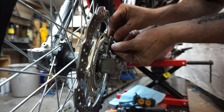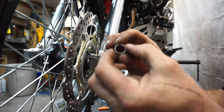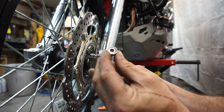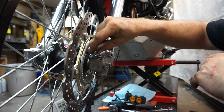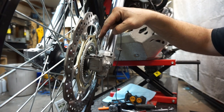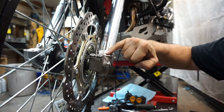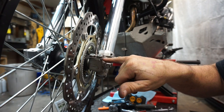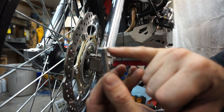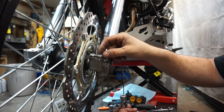We can recheck the sensor — that's good. I have cut rings here, and the ID is the same as the OD on a socket head bolt. We're going to drop these over top and weld them to the plate, so when we put these bolts in, it's going to be perfectly aligned — basically using the heads as dowels and these as locating rings. I left them just a little bit short because the tops of the bolts are radiused, and I didn't want dirt building up in here and making it more difficult to get off.